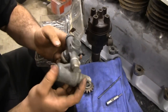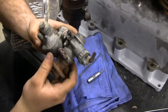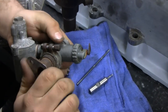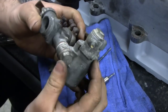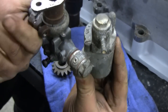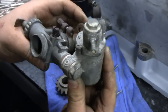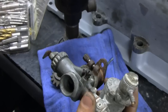Show them exactly what it does, Mike. Well, it's pretty much universal. Here's the intake and this is where it bolts to the manifold, but that flange can be rotated any which way you want. You just clamp it with this band clamp anywhere you want. And the same thing with the float bolt — it's just a banjo bolt. Whichever way you wanted it, you can keep the bowl level and have your intake anywhere you want it. Even put it on an angle — really any way, as long as you kept the bowl level. It's updraft, downdraft, side draft, any way you wanted it.